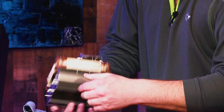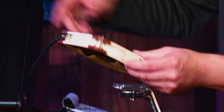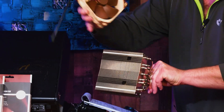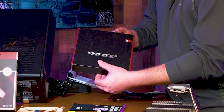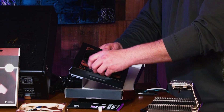I'm going to upgrade the fan. You pull these clips and the fan comes off. In this case, the way it's positioned, it's blowing upward. I found that flipping the fan around so it's sucking is actually better for this CPU heatsink than pushing. I'm grabbing this industrial Noctua PPC fan — it's a 3000 RPM fan. This thing sounds like you're about to achieve low Earth orbit when it kicks off, but you want to keep your CPU cool.